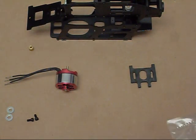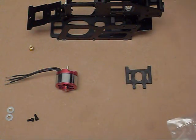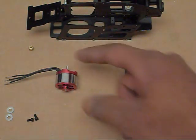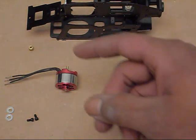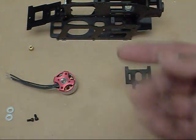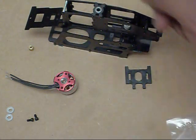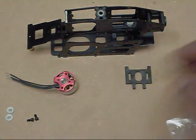Because of the motor I'm using, the first step is to mount the motor to the motor plate. Then I've got to temporarily reinstall the rotor head with the main gear so I can set the gear mesh between the motor pinion and the main gear, tighten up the screws, then take the rotor head back off and install the servos. The mounting holes on this are much smaller than the motor you would normally use, so my screws sit underneath the servos and I can't get to them with servos installed.